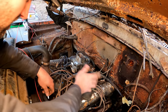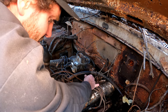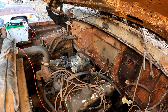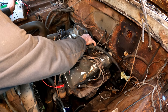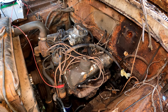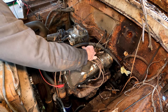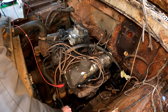Bringing Jen along — kind of making it like a date night, some date night down at the yard. Got everything hooked back up. The float was actually sticking so I turned the fuel off for now, but it should be plenty flooded. Oh — got zapped that time, jumped right through the wire to me. I think I left a vacuum hose off in the back. Yes — the PCV hose. Turn the fuel on.